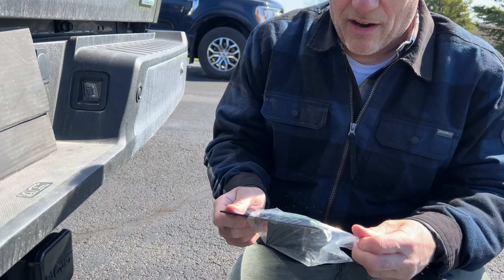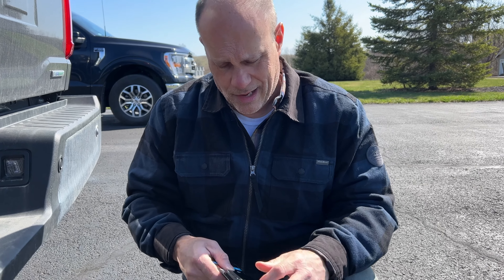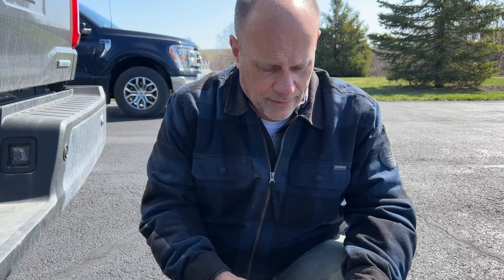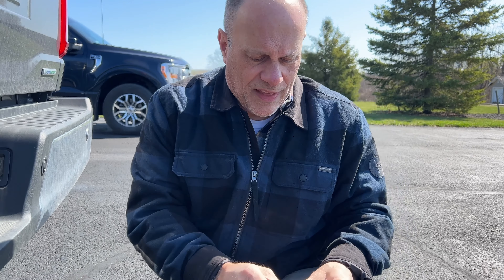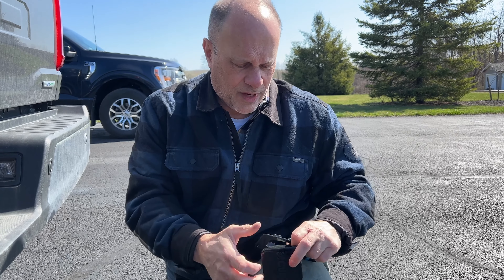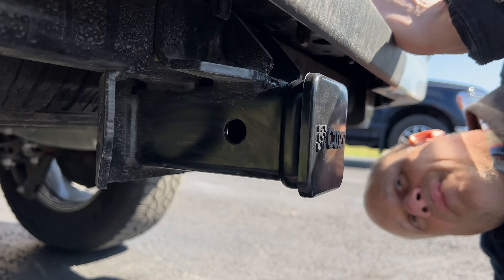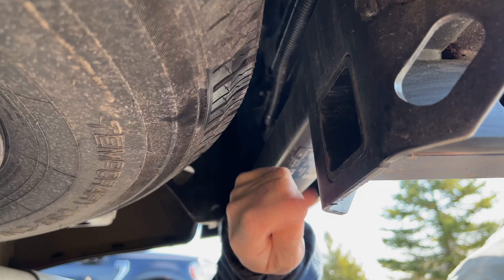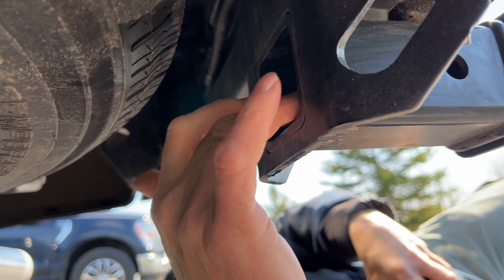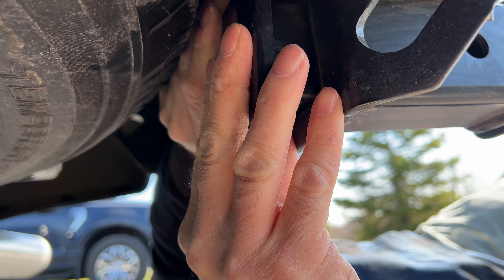Now, not wanting to stop there — I don't want to create a spot in my receiver where water fills up and is held in by a giant rubber plug. So I bought a second plug because the back of the receiver is wide open, and that's where all the junk is getting thrown up in there. I'm actually going to take this underneath and mount it on the backside, which you can see is wide open here. So I'm also going to seal up the backside with another rubber plug.